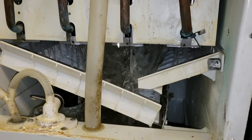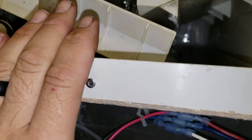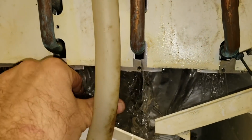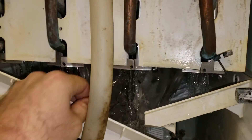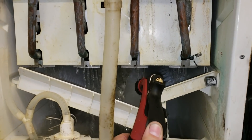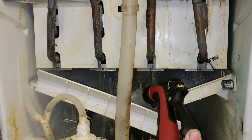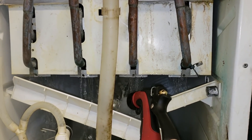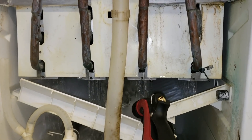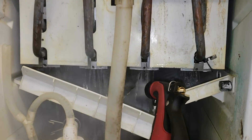I'm going to grab a water hose, get some hot water in here, and help this process along. I wouldn't be surprised if we break a cube guide, because look at how much ice is coming down — that's a lot of weight pushing on that plastic cube guide. This is just my method; the way I like to do it. I feel like the water pump's helping me circulate that hot water. Some people choose to defrost from the top — I've done that before too. Each to their own.